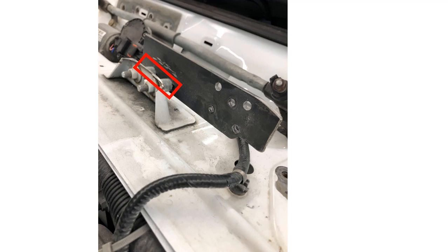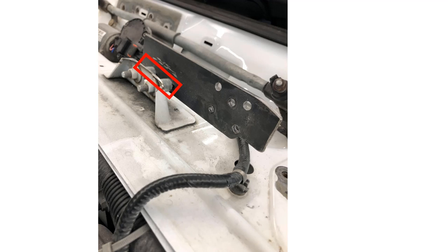If the bonnet is rubbing against the cowling, remove washers. Later we can replace all the washers with an actual bushing, but for now let's use washers. Determining the proper number of washers isn't critical at this step, and it is difficult to figure out because the cowling is not fastened in place — it's moving around.